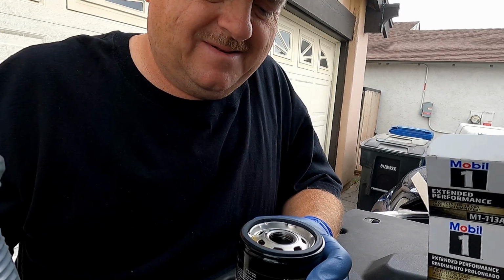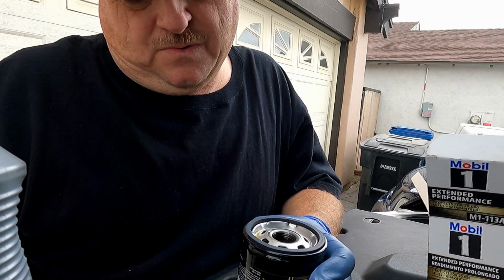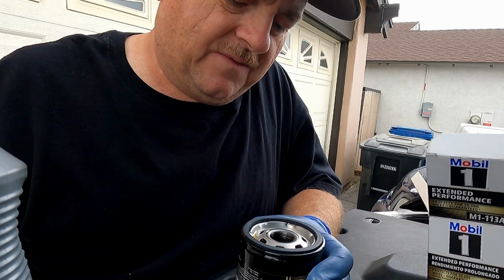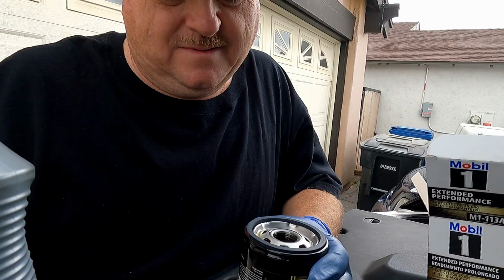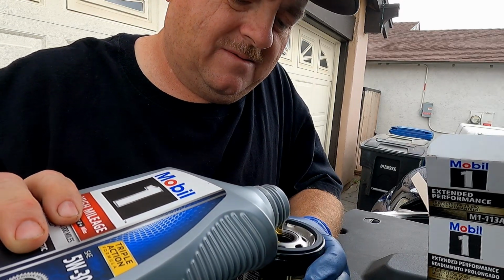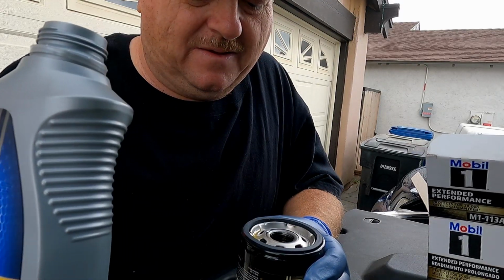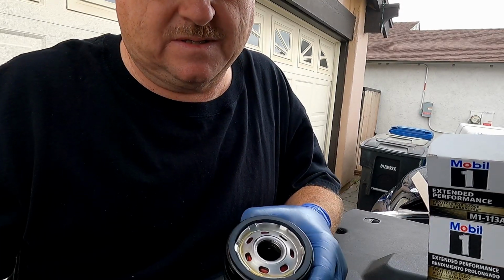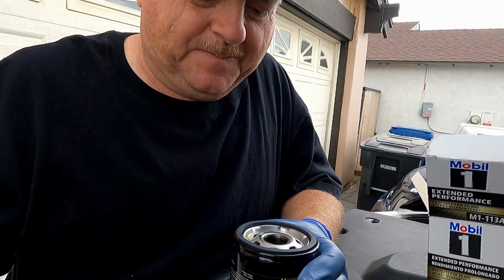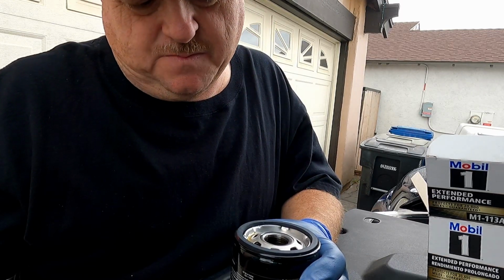And it'll go down, and you get it to where it was starting to get heavy. You can fill it to where it won't go down anymore. That's what I'm trying to say. And it'll have that much more oil in the system ready to go. Just a best practice. I mean, you don't have to do that. It just helps to do it. I wish you could see the air bubbles in there. I don't want to tilt it to spill it, but the air bubbles are just the oil getting to all sides of the oil filter through the filter media.